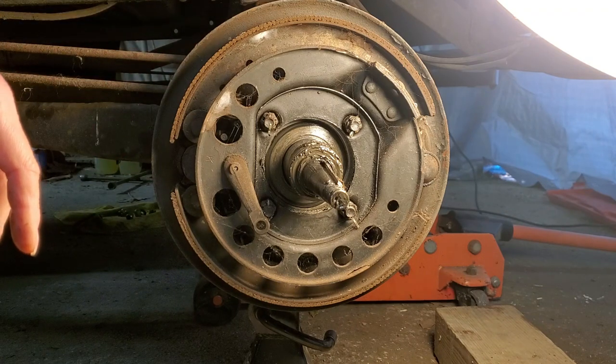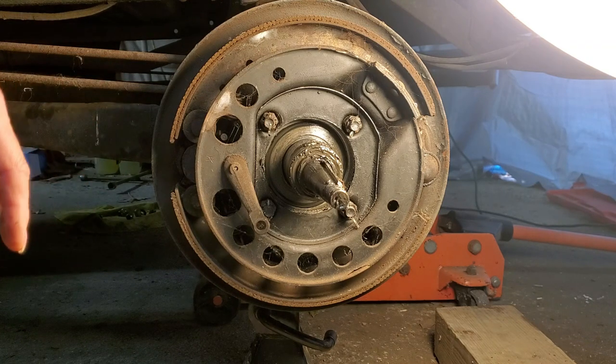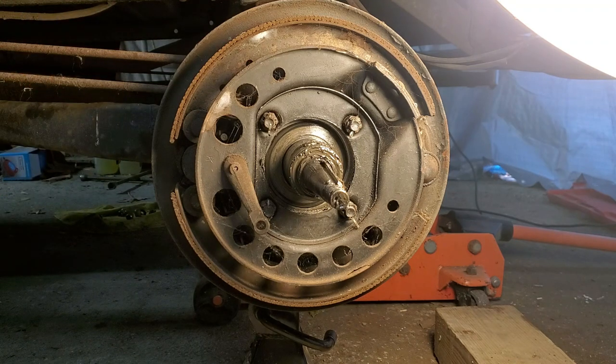The rods look all right. I might replace them anyway. I'm surprised the eyes and clevises were all good. They're not really worn. The clevis pins had a little wear to them, but the clevis itself didn't. So hopefully I can go with the original brake rods. Anyway, on to this.